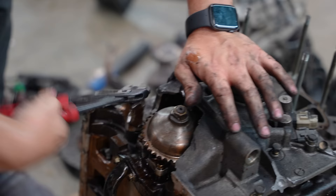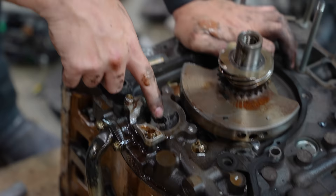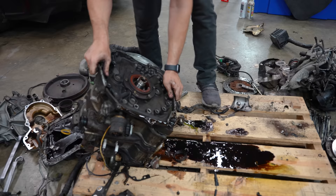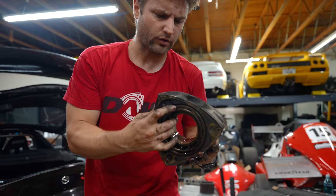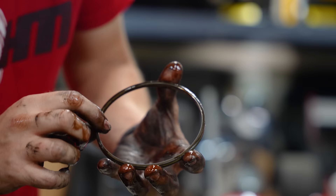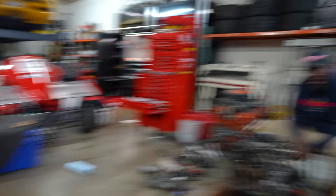You know what? This is not normally part of our process. The wobble bolt — if we were trying to rebuild this, look at that. Oh my god, that's the oil pump. That's gone. So this front iron is gone. All these seals are flattened. It's been through shit. Obviously it was a gasoline motor. This just saved him whatever, $150? You guys should see the list I sent him — it's just parts, no labor. Just the parts needed for four rotors. We're in this together. Let's just say we no longer use Vaseline to pack our rotors.